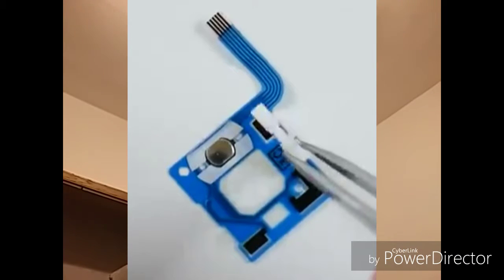In this picture I'm showing you, right underneath the stick, there's these metal parts that rub on a graphite surface as part of the circuit board inside the Joy-Con. The rubbing will then slowly cause the graphite to create dust, making the circuit board confused on the movement of the stick.